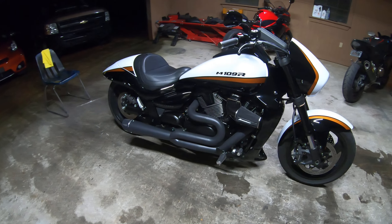It really wakes these bikes up and removes the restrictions. He also adjusted my electric fans to come on at 196 degrees, tuned on 93 octane, and adjusted the ignition timing for more power on the top end. The bike runs pretty well.